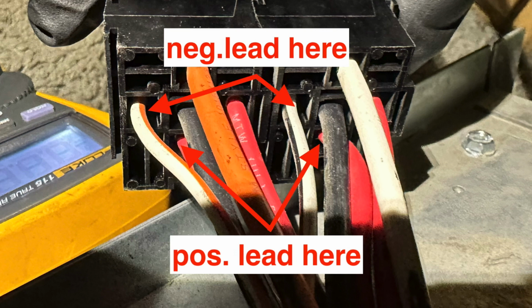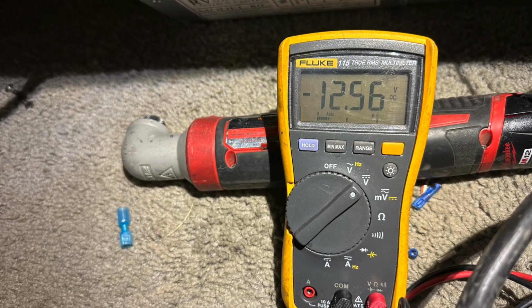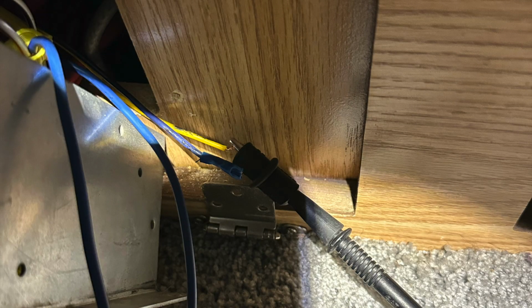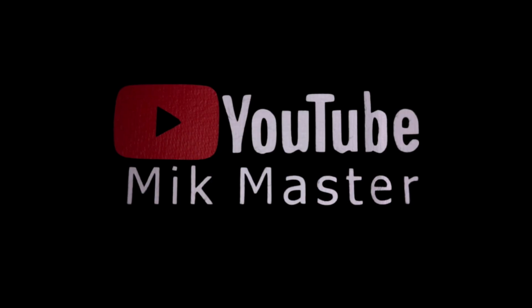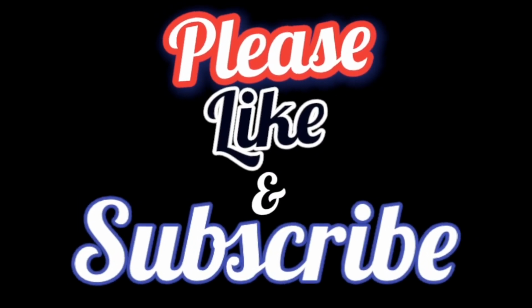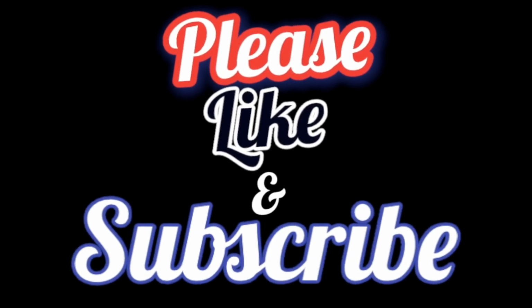That's important for me in this situation because of the way my tool works. I'll put a link in the description for a video on this tool I'm describing. With the red meter lead connected to the wire that's coming from the switch, when I depress the button, I got negative polarity. That's how I knew it was a negative triggered switch. Here I've got the black wire on the switch, the other lead going to a positive, and then I have proper polarity. That's how I figured out the right polarity for that circuit and was able to fix that slide out using that tool. That tool made it a lot easier. So check out the other videos in the description, and thanks for watching.